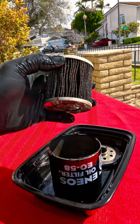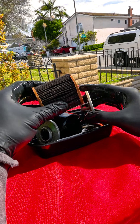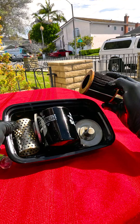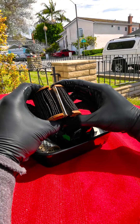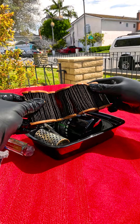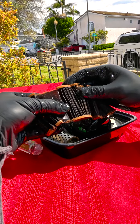This is just paper material inside. In the middle right there, you'll see if you have any metal flakes, rocks, silicone, or whatever. Take off this cap, and then we're just going to split this open. There's another inside piece right here — there's actually a lot of components that go together to make an oil filter. I'm just going to open this up like this — it's just paper, and you can open it up like an accordion, see that?